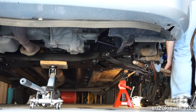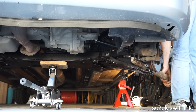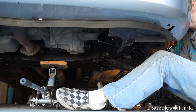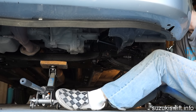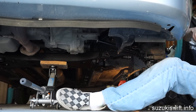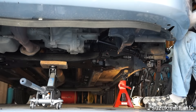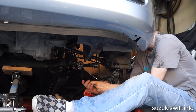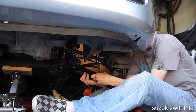With all the bolts removed, knock out the ball joint of the wheel assembly and the control arm will wiggle out. When installing the new control arm, do the big bolt first and work back from there reversing the process, and don't be scared to use a hammer to make things fit.